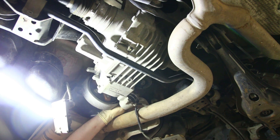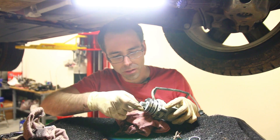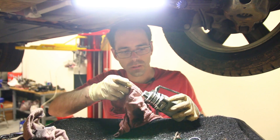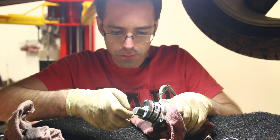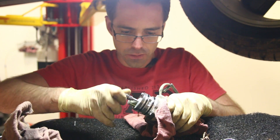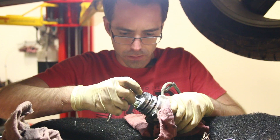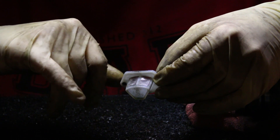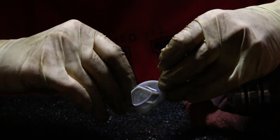We can drop this pump out of place. This is the screen we're going to be cleaning up — it looks like we can actually just unbolt it. We're going to take it, unbolt it, and clean it up so we can blow everything out. We'll need a T10 Torx bit for this. It appears there's more fluid in there than necessary. There are some particles on the screen but nothing too much — this car has fairly low mileage so I wouldn't expect much. Depending on how much you launch your car, that may get worse.